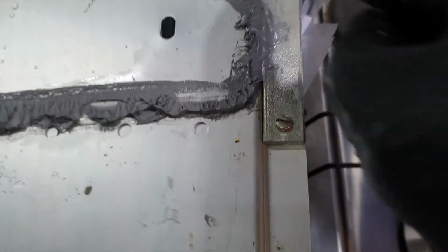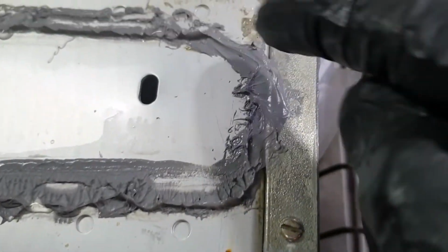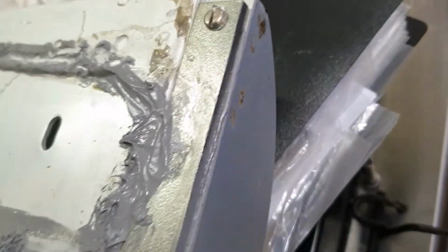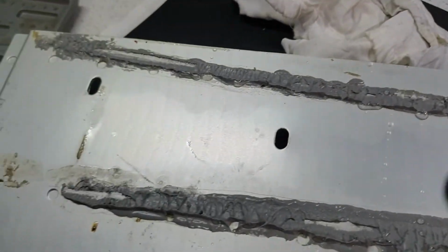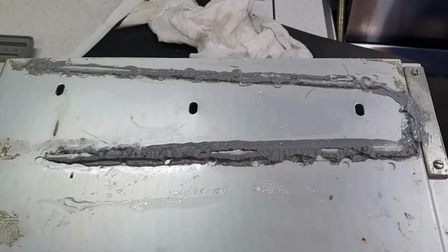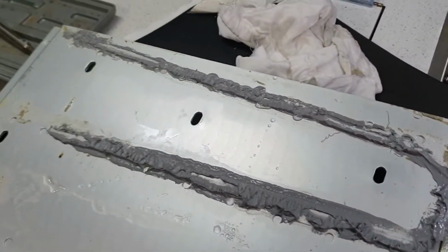I think this part here was quite. Actually, the pipe came over the edge of this little step. You can see there's a little step here, and was actually not contacting anything at that point. So I added this piece of aluminium on here, and I've got a thermal compound between those two flat surfaces there to transfer some of that cold. So I'm working on the premise that every little bit is important in one of these fridges. So these sort of gaps you get here, and there was gaps up here, you know, will end up with a poor output as far as the fridge goes.